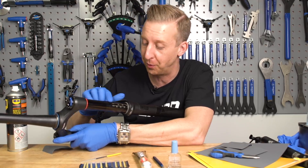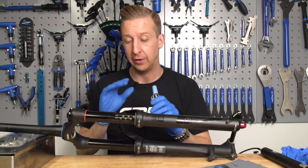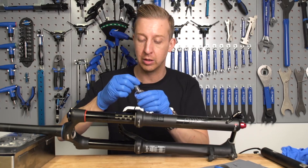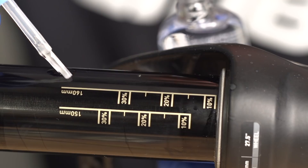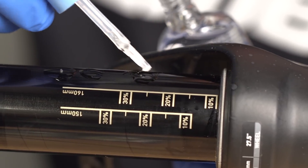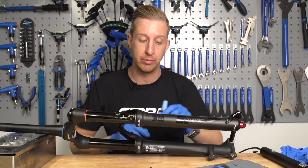In this case it's just nail varnish — nice and simple. Some people like to use epoxy resin, which you can get in gray, black, or different finishes. This is just clear. If you're bothered about the color of your fork you can match it, but I'm purely about the function. I'm going to go quite liberal here because I'm going to smooth this down afterwards. Something really important to note: you must leave it until it's completely dry. If you don't, when you go to polish it up you're actually going to pull it straight back out of the leg. Leave it until it's absolutely rock hard before moving on to the next step.